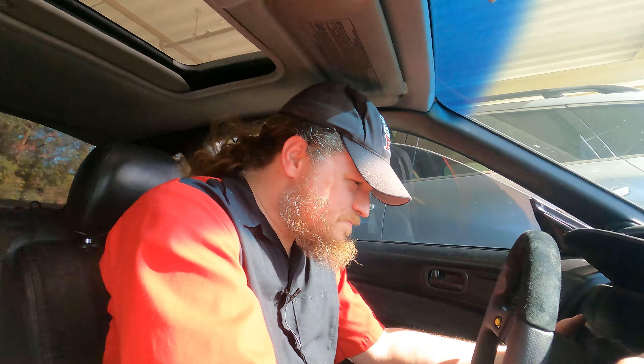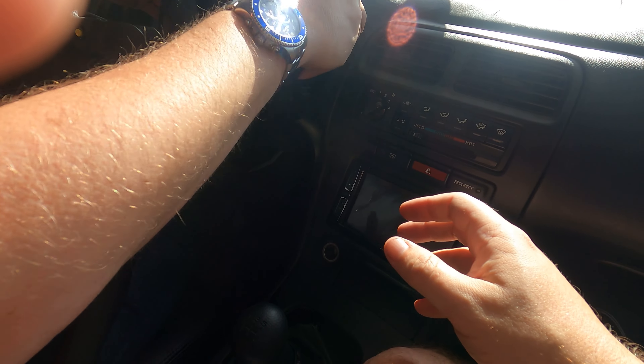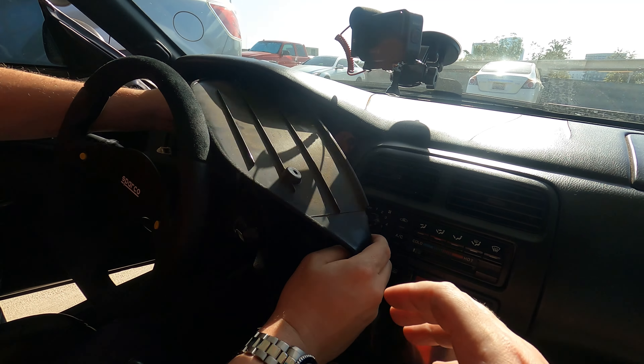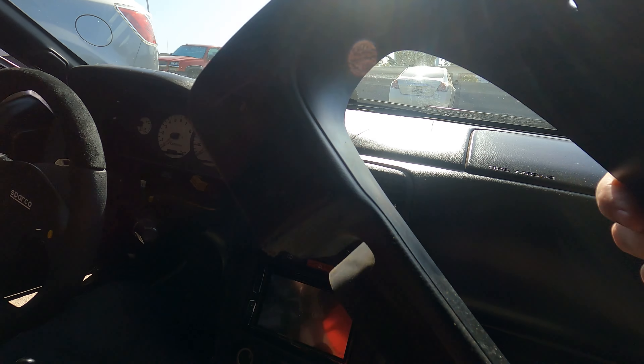As a note, if you have problems with the electrical connectors, one trick I always use is to use something like a flathead or Phillips head to push on the tab, because it's kind of flat and you have to get it high up there, and if you have fat thumbs or fingers it's kind of a pain. Just use this to push on the tab and you should be able to pull the electricals out pretty easily. Finagle it until you figure out how to rotate it out — and we got it.